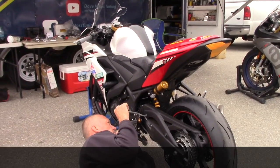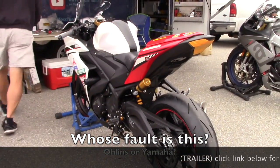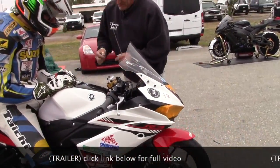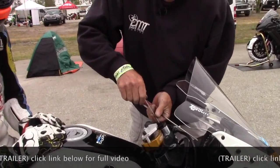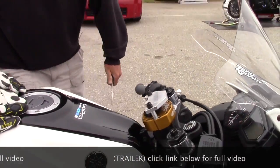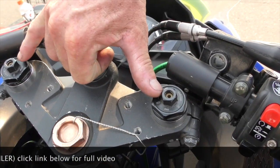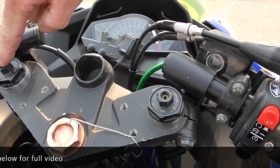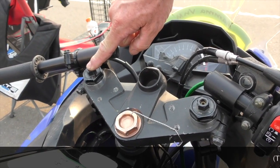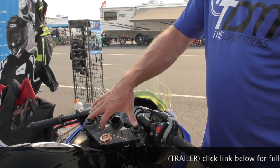Is this shock special? Did you cut it? Yeah, it is. So front tire's cold, pound out, not enough travel, two clicks off the compression. You've got preload in both. You've got rebound in the right leg, compression in the left leg — just like any other 30 millimeter kit or 25 for that matter. These are valved and sprung specifically for the 300.